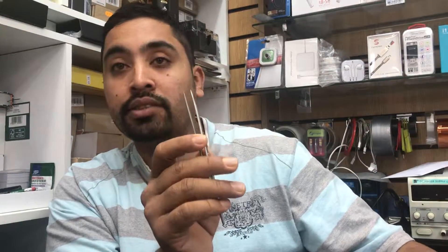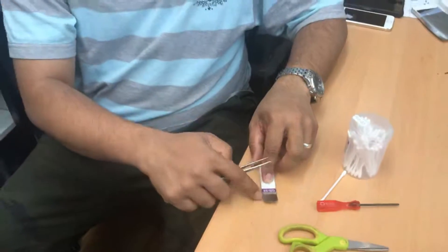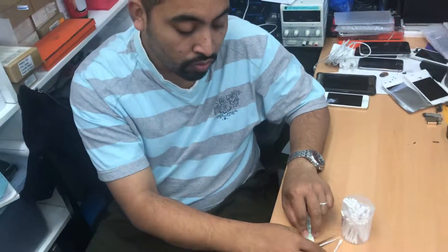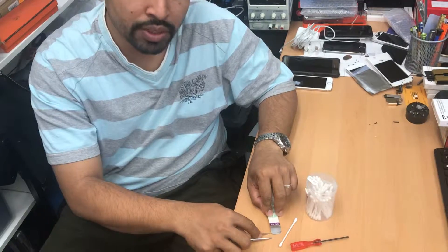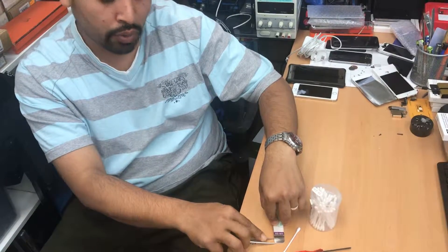So, what you need to reconnect the keyboard flex if you're struggling: take any small plastic tool (plastic is best), and use a cotton bud for extra support to bring the flex up a little. Make sure you take out the battery first. One side of your tool goes to the actual motherboard connector at the front, and the other side goes underneath the flex — then try from one side, then the other.